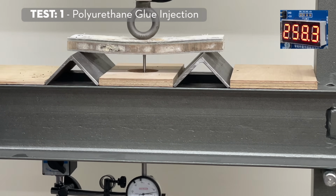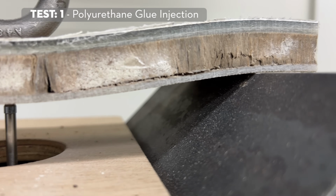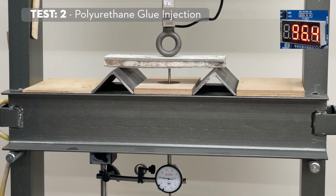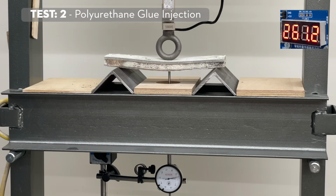You can hear it starting to crack, and I can see a little separation along the bottom. Again, it's that bonding layer between the skin and the substrate that's kind of hard to manage. The second test sample only handled about 270 pounds before it started to fail. So now please enjoy this ASMR experience while it continues to give way.